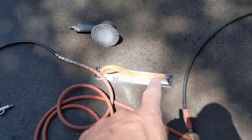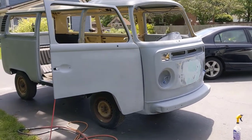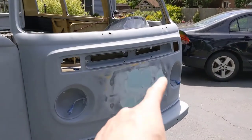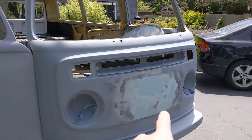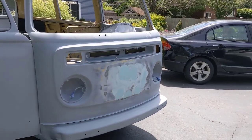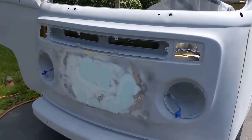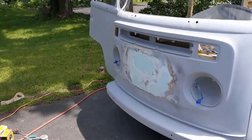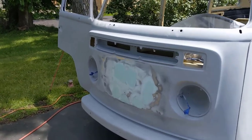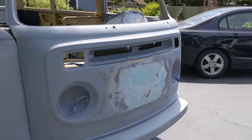I'm going to start doing more of that, starting with the longboard on these areas. Doors are at least bolted on just so I can kind of get an idea of how that's going. I'm basically just working back and forth on this — just sanding and finding low spots, adding a little bit of glazing, sand prep, and see if I can get it better. It already is going to come out a little bit better. This time instead of just slapping filler on there indiscriminately, I'm really just concentrating on the low spots and seeing if I can build them up. We'll see once I prime it.